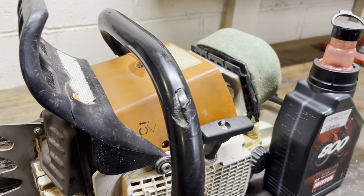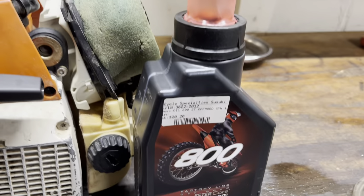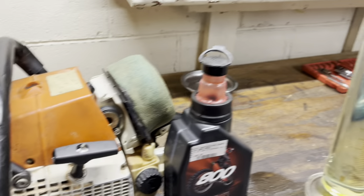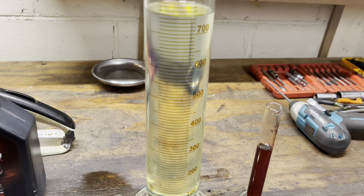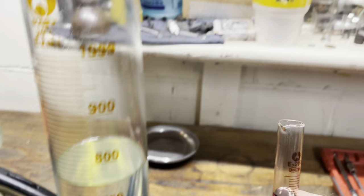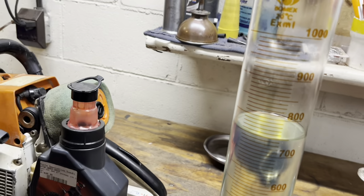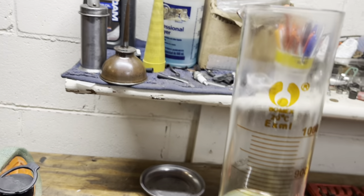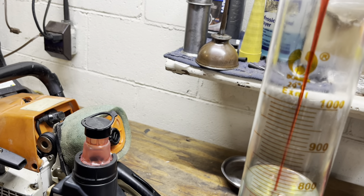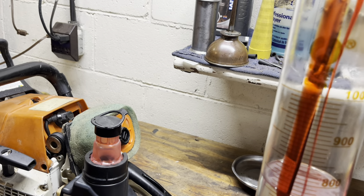It's Saturday and I am finally getting around to opening up this bottle of Motul. We're going to mix up one tank of gas, same thing as last week — 750 milliliters, 19 milliliters of oil. I'll pour it on the side of the beaker.